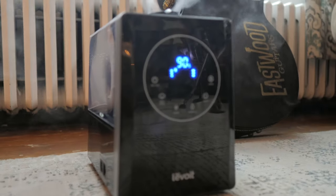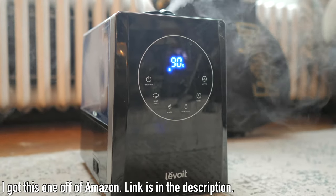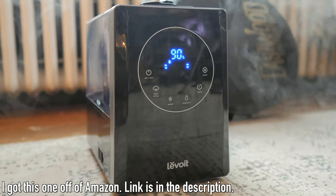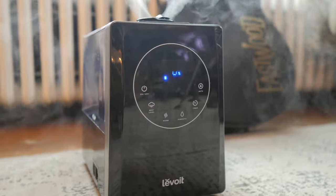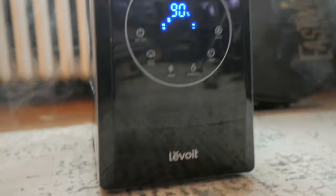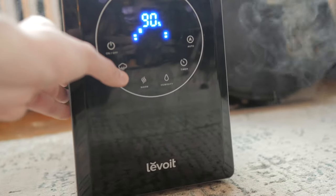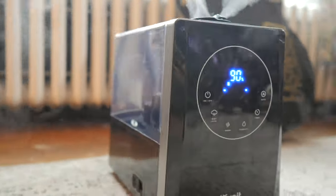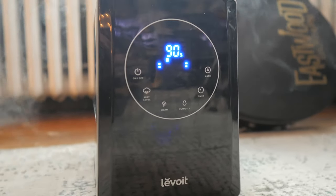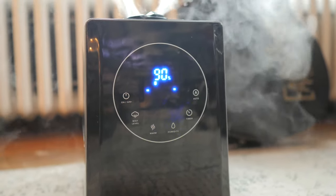This is the humidifier I use in my room — it's made by Levoit. I'm sure there are other brands that produce basically the same product. It was relatively cheap and it works well, so this is what I've been using the last few years. The tank is between one and one and a half gallons and it's got three different mist settings. In the winter if it's above freezing, setting one is usually fine and the tank will last about a day and a half. On the medium setting — if it's around 30 degrees outside and you want to keep your house at 67 to 69 degrees Fahrenheit — the tank will empty in about a day.